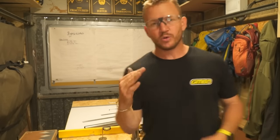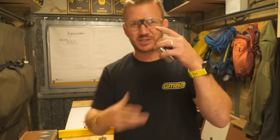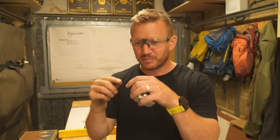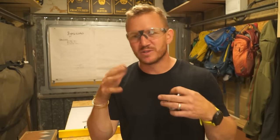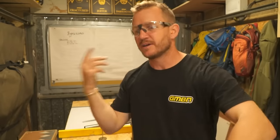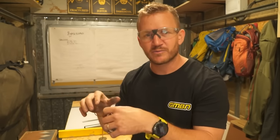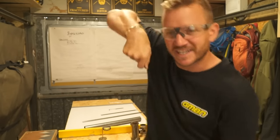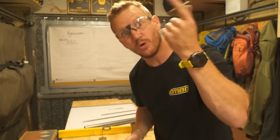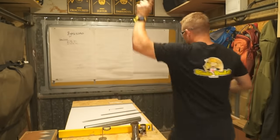I'm just gonna cut all the tubes to the right length, because before I start welding them all together, I need to put in all the little accessories that I need to do now, before it's all welded up. That makes sense, because it would be super hard to do all the little trinkets on the frame when it's fully built, because I won't be able to get in there. So I'm gonna do that all before doing the welding. Down tube.